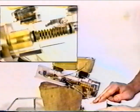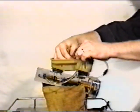Because of the size of the low pressure chamber, this will take approximately 12 to 15 strokes to remove all of the air. Watch the primary reservoir for any signs of air as the process is completed. When complete, disconnect connector from tool output and let the hose gravity bleed until a solid stream of fluid is seen. Position the bleeder hose into the primary reservoir to prevent draining.